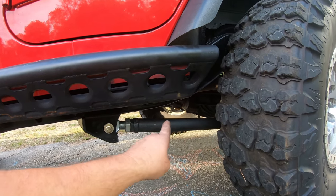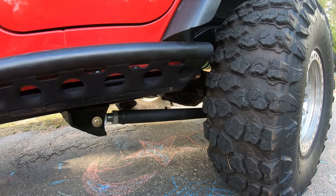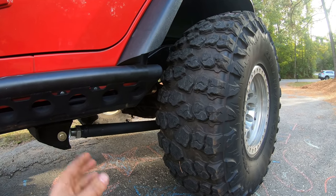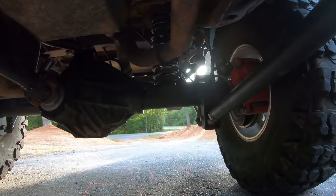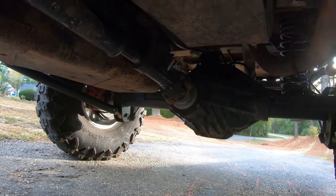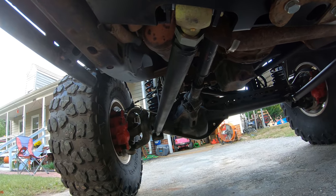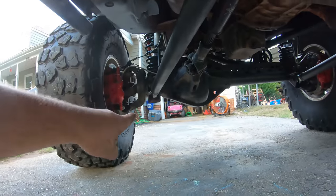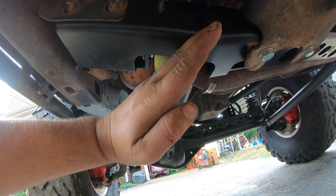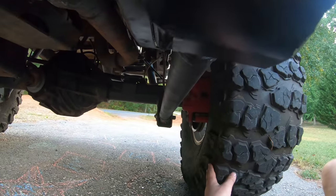If you really wanted to, you could get the lower link bent for a little more high clearance. It'll be hard to find someone who can bend two-inch DOM tubing, but there are shops that could do it — just make sure you bend it before assembling everything. Our third-link mount is up there — we have the bend, our truss bracket, and it bolts in. Under here it's very simple. We have our cross member with the offset Enduro joint going to our axle-side lower mounts. These offset Enduro joints are a game changer — right now the joint is at zero misalignment; if this were a normal heim joint it would already be almost maxed out.